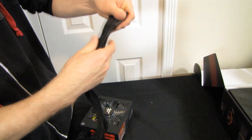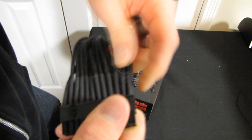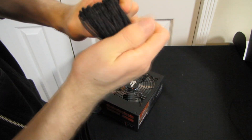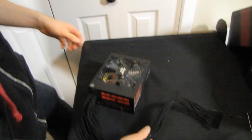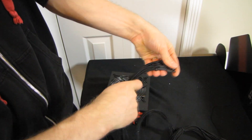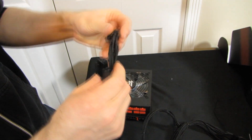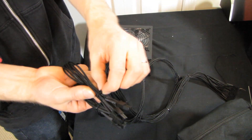The disadvantage of individually sleeved cables is they do make the cables quite a bit bulkier. The sleeving quality is very reasonable — the heat shrink might be a touch on the long side, but it's not the end of the world. You'll want to cut the zip ties and get things arranged nicely, running them flat behind your motherboard. But where you see them, they actually look a lot sharper — especially on graphics cards where you can run individually sleeved cables and prevent any unwanted cable color from showing.